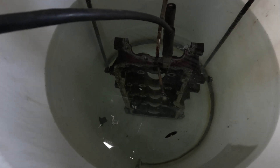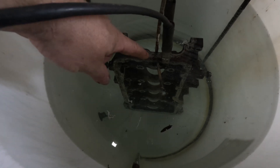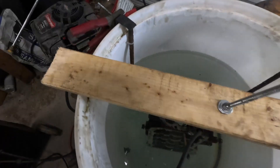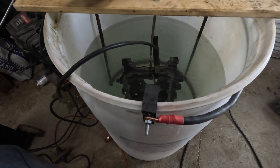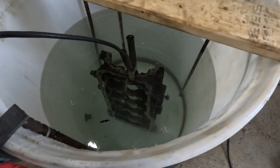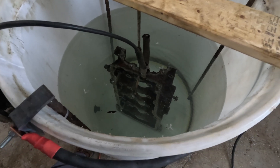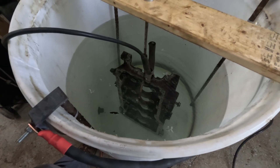You should be able to see it working in there. What I've got on here is basically just a standard battery charger on two amps — I'm clamped on to the block and over here I'm clamped on to my lead that jumps around. The wrench is just hanging there; I put it on so I can raise this up and down as needed. Right now our electrolysis is working — we've got baking soda in there and it is actually eating the crud off. I'm going to leave this, let it run for a couple of hours, and come back to take a look at it.